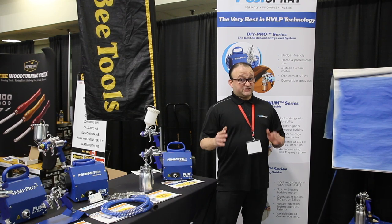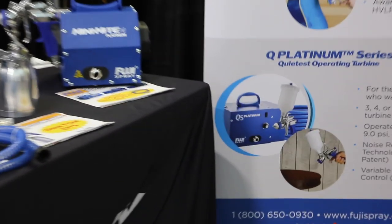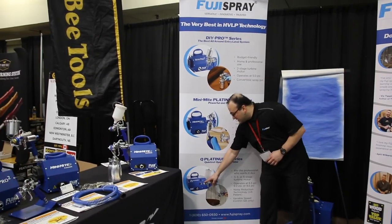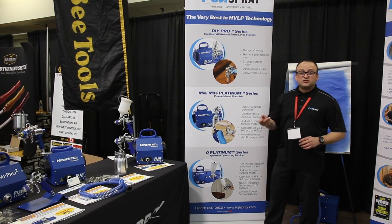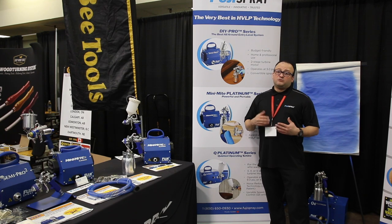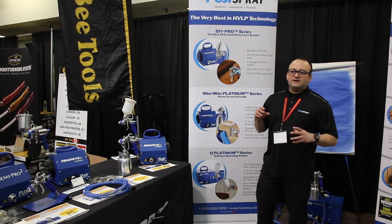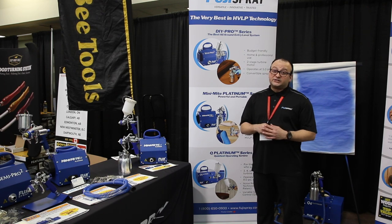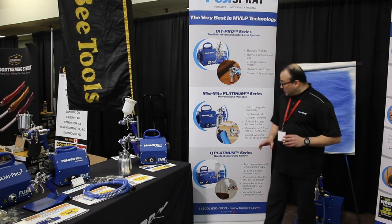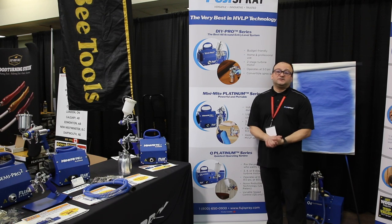Now with the 5-stage, on the other hand, which we have a picture of over here, you can either get a Mini-Mite 5 or a Q5. The Q5 has a speed control dial that allows you to slow down the motor speed, and you get a lot of benefits out of it. Not only do you have a turbine running at cooler temperatures, it prolongs the life of the turbine itself. So the Q5 is the only turbine that we offer that has the speed control dial.